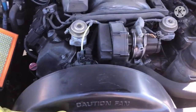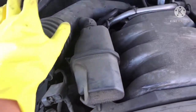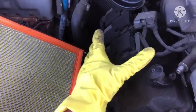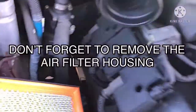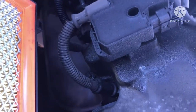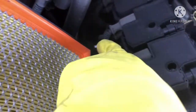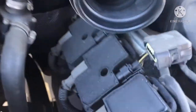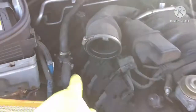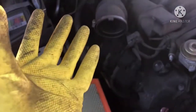What I did so far is I took the engine cover and the upper housing of the intake out. Now I'm left with this intake tube that goes to the intake manifold, and I have access to the spark plugs. Oh wow, this car is oily — has this car been burning oil or leaking oil? Anyway, to get to these spark plugs, they're held down by these little coil wires over here. All I need to do is pull them. That one all the way back there is going to be a challenge, so I'm going to fish my way through. There are six spark plugs to take out over here — it should be doable. I'm going to do one spark plug at a time.